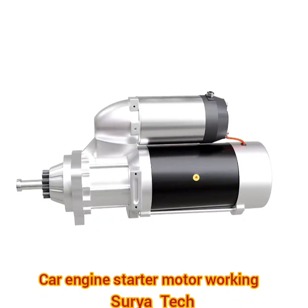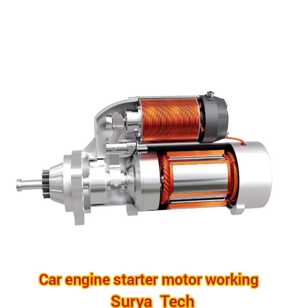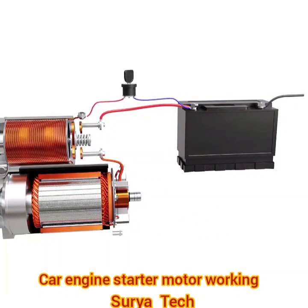An engine starter motor is a powerful electric motor used for cranking an engine. The starter motor has a pinion, which meshes with the teeth on the flywheel of the engine and turns the crankshaft. The model shown here is a pre-engaged type starter motor used in modern vehicles. It uses an electric motor to provide torque to the crankshaft. The power for this motor can be drawn from the battery.